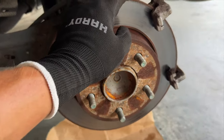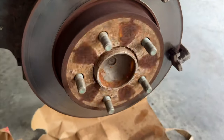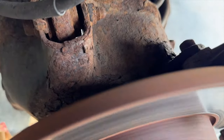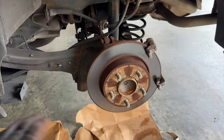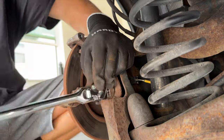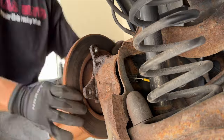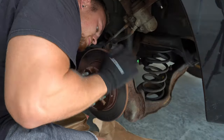This is definitely what's causing that sound. This should be silent, but listen — sounds like there's loose marbles in it. It should not sound grainy like that at all. Using a 14 millimeter socket, remove the two caliper bracket bolts. If your rotors are rusty like mine, spray some WD-40 in the holes to help loosen it up. Using a couple loving whacks, it should come right off.